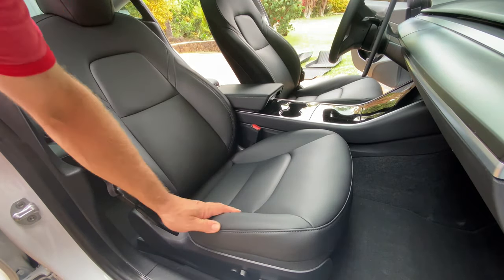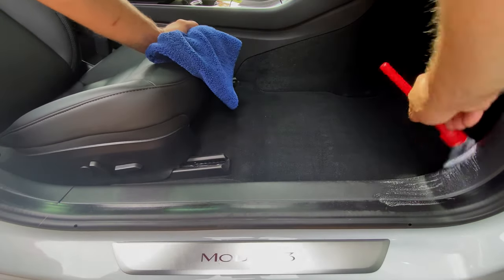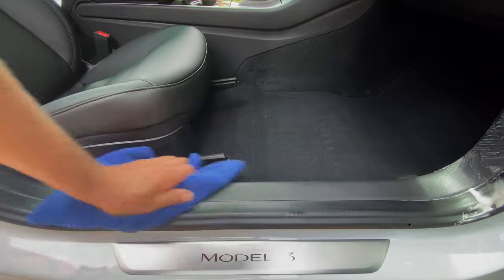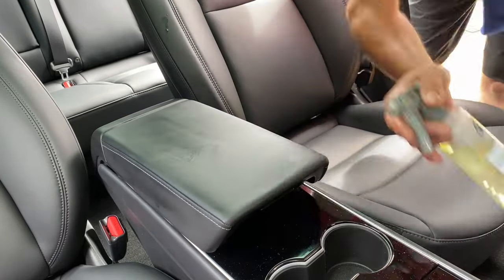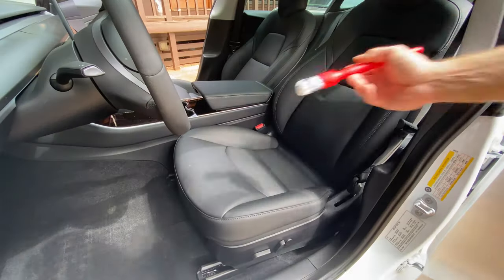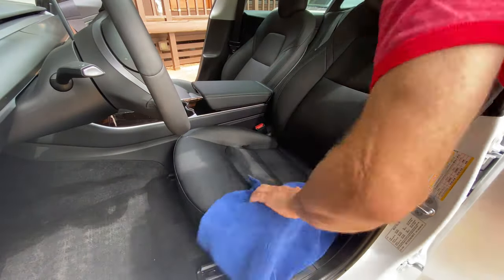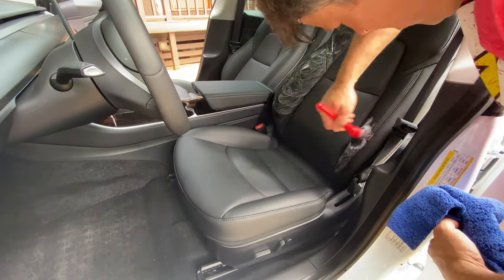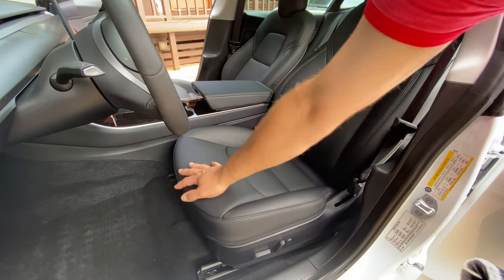After buffing it out, that seat looks brand new. We'll continue working our way around to the seat controls and then down to the door jams. A common detailing error is to try to use your favorite spray protectant to clean the interior — it just doesn't work, it just buries the problem. We want to make sure to use the right products for the right job. The center console is another area where skin contacts the interior and leaves body oil behind, so we want to make sure we get all that off. Now we can go ahead and repeat the process on the other side. The driver's seat is extra soiled so we go a little heavy with the cleaner, good agitation, and buff it off. Continue to add product and agitate as needed until you get a result you're happy with.